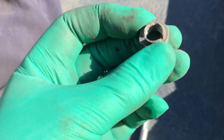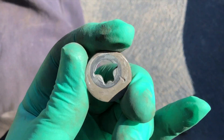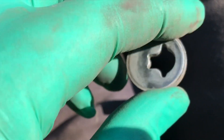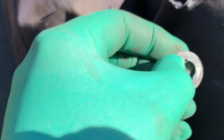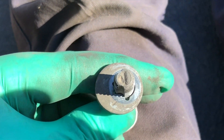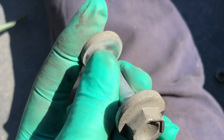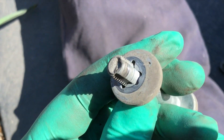The castellated nut - the castle goes to the outside when you screw it back on. Then there's the washer - look at that for a washer, like a little ghost shape. You have to line that up with the two slots, and the shiny side goes against the surface with the little nut on top. It slides on - you look at it and think it'll never go on, but it does. When you make the adjustment at this end it makes the same adjustment at the other end, moving everything square. Whatever you do, don't reef on the head end - you'll muck up your adjustments. You've got to unscrew from the nut end and put that washer on right so it can be adjusted for your wheel alignment.